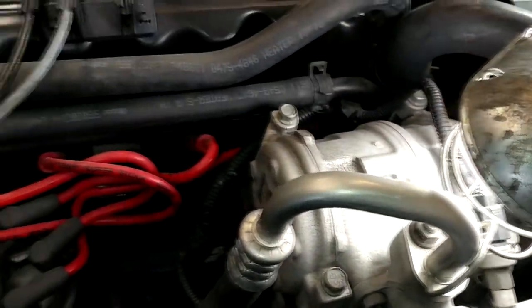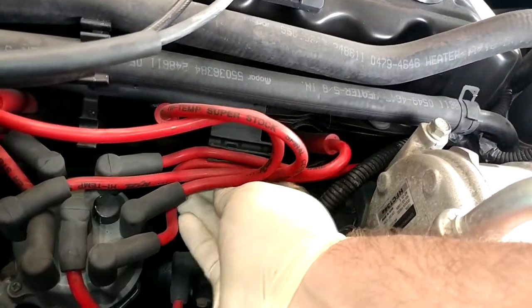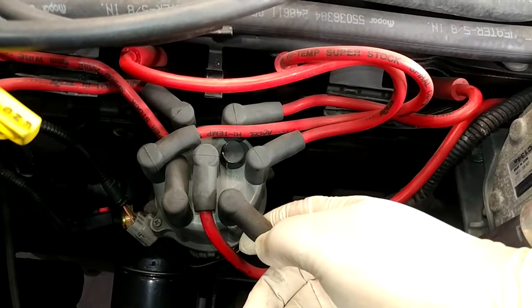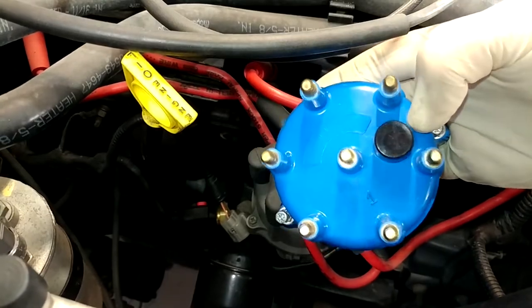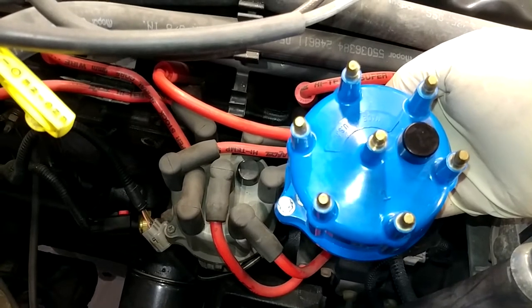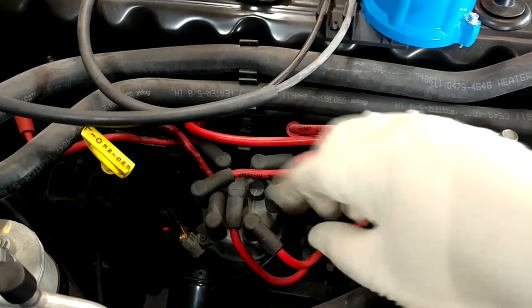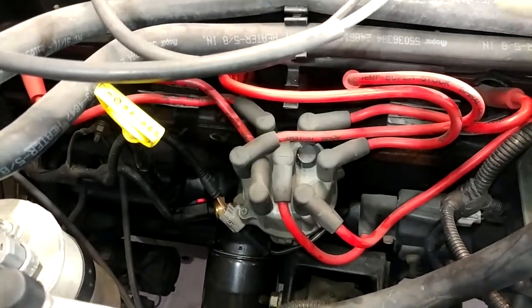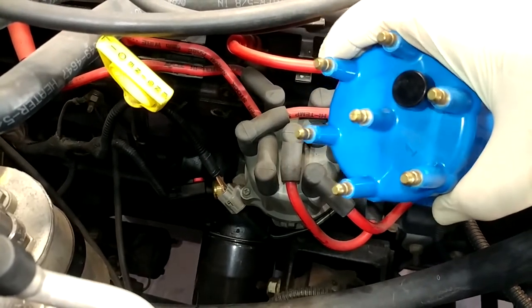I'm going to take a quick minute to get the air intake hose out of our way just to make life easy. Now I've got number one up here behind the AC compressor — it routes into this clip right here. These are Taylor Superstock wires that I ordered from Summit a long time ago, and they are gigantic and they've never actually fit the factory clips very well, which is why I didn't use them again. Let's go get our new cap, make sure it looks about the same as far as the bolt pattern, and it does. On this nice high quality one they actually already marked cylinder number one for us — right there it says number one.